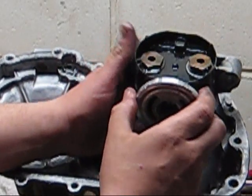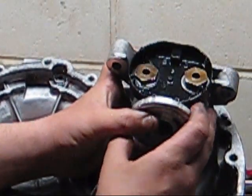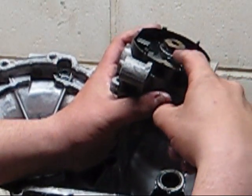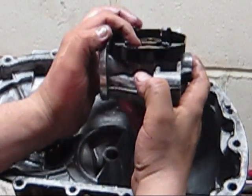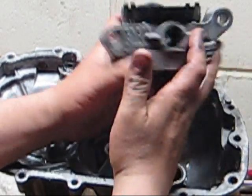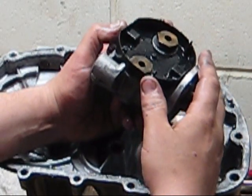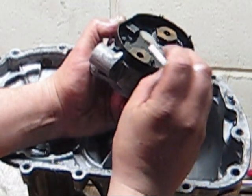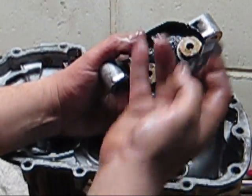So what we found was, when I took this apart, we looked at everything else, everything looked good, no visible damage. Took this apart, you can actually see in here that this wasn't seated. This one is all the way down, and you can see it's torqued down, I'm sure, all the way to the plate. Well, this one wasn't. It had come loose, it just moves in there. And so that was keeping these plates from hitting the check balls inside, which releases the pressure.